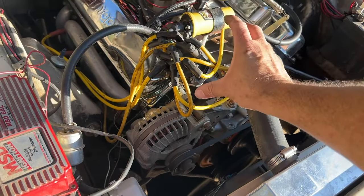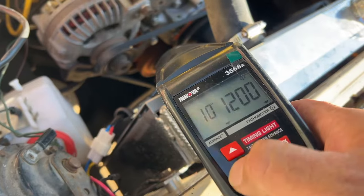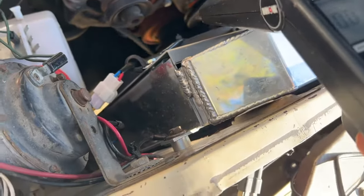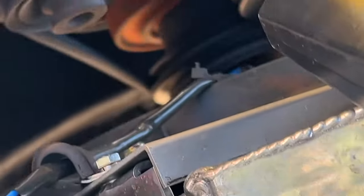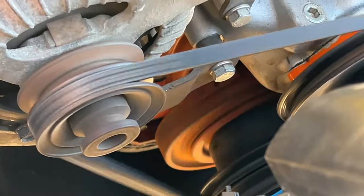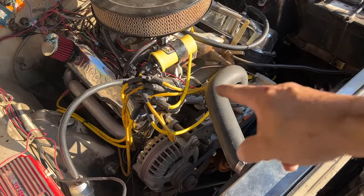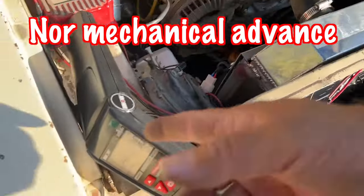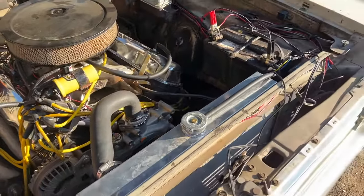When you're adjusting this number, this isn't really changing the timing — you have to physically move the distributor to change the timing. All this is doing is just telling you what it is. Let's say we started from scratch and it's zero degrees. When you look down at the timing mark you can't see it — it's way advanced. So you're gonna advance the timing up, watching the mark and bringing it up to the zero mark. Whatever this number is here, that's your timing. This is 28 degrees. We locked this distributor out so there's no vacuum advance, that's why it's fairly high. With a stock distributor you might be at 8 to 12 degrees advance at idle.